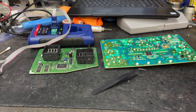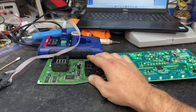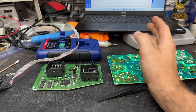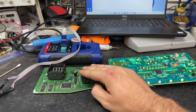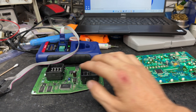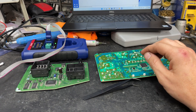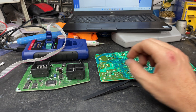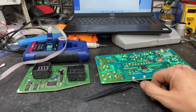What I actually found out with the vehicle — this is the cluster, this is the BCM. The BCM had actually been swapped out with a used one and that's when this problem started. The BCM is actually responsible for the mileage; it's in this little EEPROM chip right here, and the cluster pulls that mileage out. With this one already having mileage in it, there was a conflict, so this one just stopped recording.